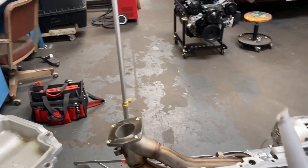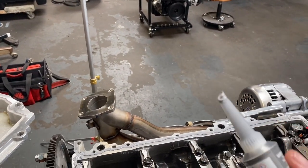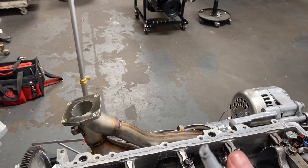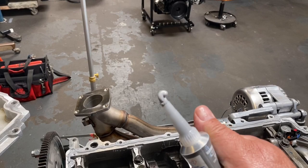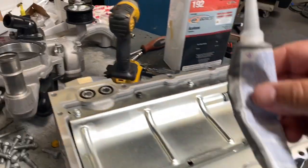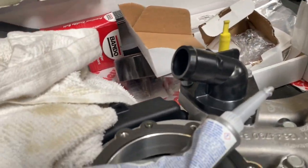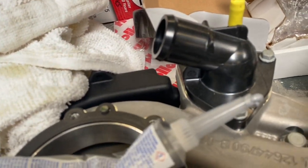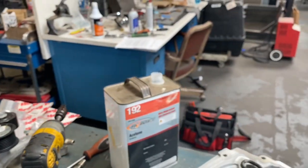Okay. Oh, tech tip: when you get done using a silicone tube, cut it off, it's fresh silicone. I hate picking up used ones and it's all hardened, so I squeeze a little bit out. Not that much, put a bend in it so it's not laying on the ground. And then set it someplace and let it dry. Now next time you go to use it, you just snap off that little rubber dolly right there on the end and good to go.